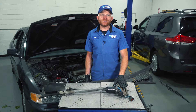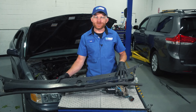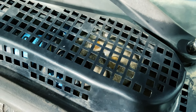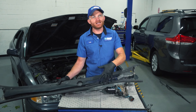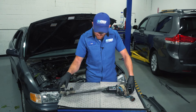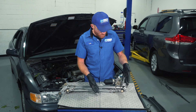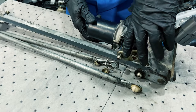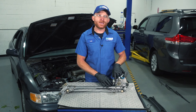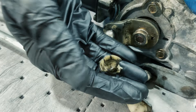Now we've got this over on the bench. While this is in the vehicle, it's covered by your wiper cowl, which does have ventilation — meaning your wiper motor and transmission are exposed to the elements and temperature. Extreme heat in this area can cause issues. Looking along the bottom, here's where the issue actually lies. The wiper motor adapter and transmission have a whole bunch of pivoting joints — these are typically a ball and socket type of apparatus. The ball is made out of metal, but the socket is typically made out of plastic, and the plastic is the weak point.